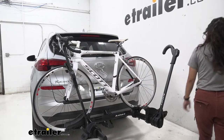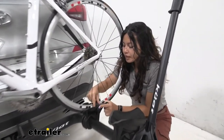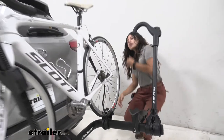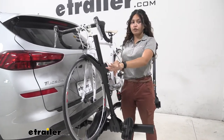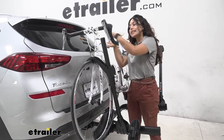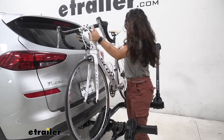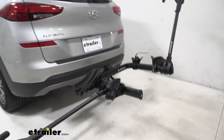When you want to take your bike off, start by the rear wheel strap: press the lever, pull that strap up and then out. Try to leave it to the side so it's not tangled in your spokes when you take your bike off. Then go to the front — hold on to your bike as you do so, because the moment you release this it may tilt backwards. Press that button, lift up on that hook, push that out, and from here it's just a slight lift and you're ready to go on a bike ride.